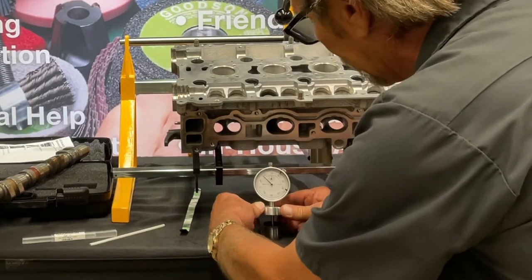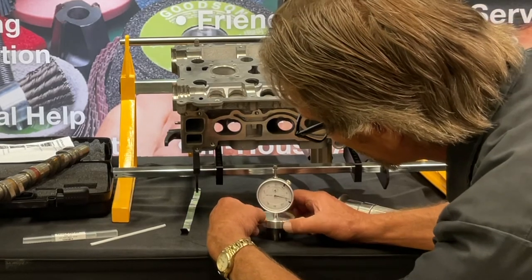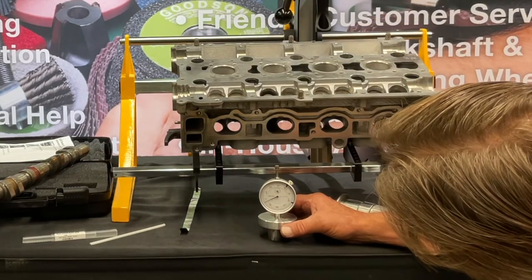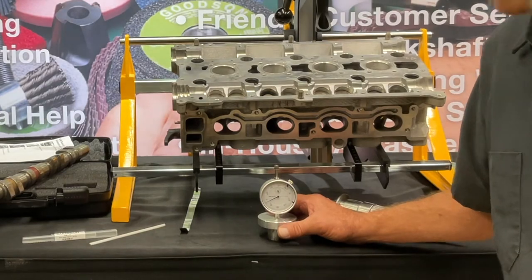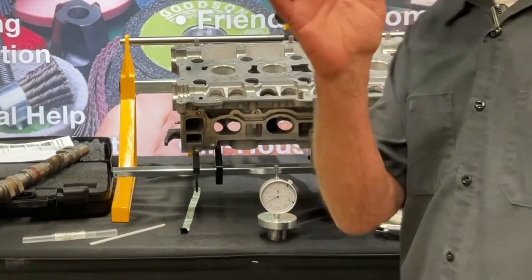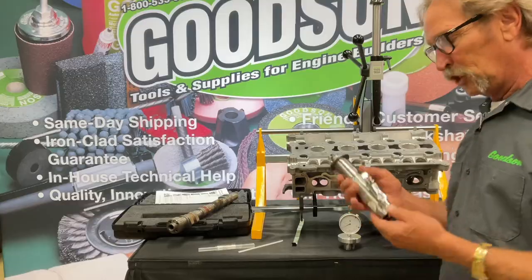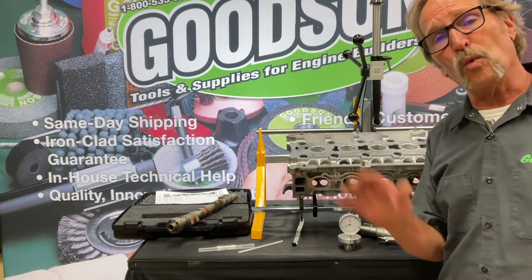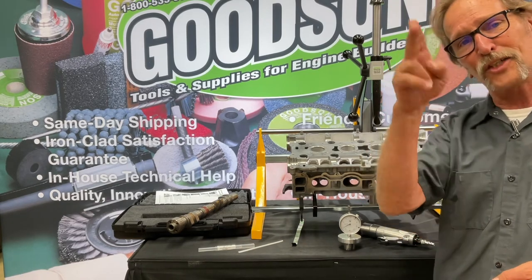Let's find out if the micrometer did work. I'll set the dial indicator back on the top of that boss — it's a little bit of a balancing act getting it right where I want it. Looks like I've taken about five thousandths off on that dial — right about five thousandths. I've got a little bit of wear from the CBN and a little inaccuracy from fumble-fingers Monahan getting that set up, but the tool works. The BLG 1000 is what you need in your shop if you're doing a lot of multi-valve overhead cam cylinders. Got questions? Call us at 1-800-533-8010 or visit us at goodson.com. Thanks for watching — we'll see you next time.